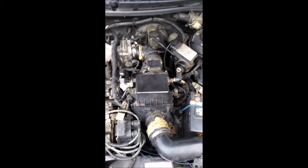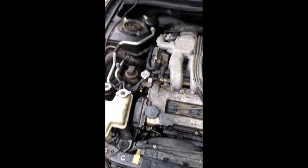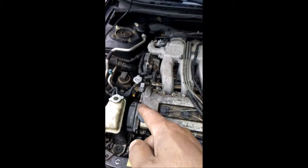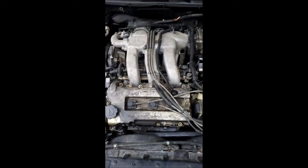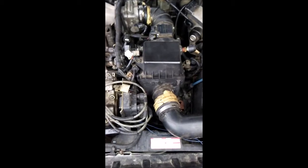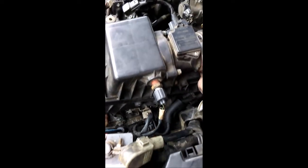On the passenger side you've got your reservoir and your cap, and that end is where you find your water pump — we're not worried about that. We're focused on the thermostat. This is a 1999 Mazda 626, and since it's a foreign car everything is in millimeters. I've been dealing with 11 millimeter and 12 millimeter, and I'm about to take this off right now.